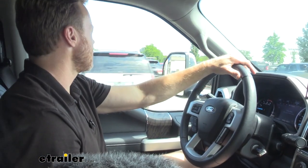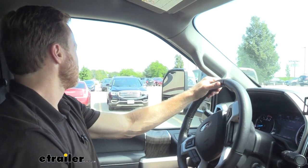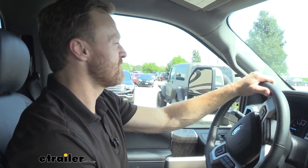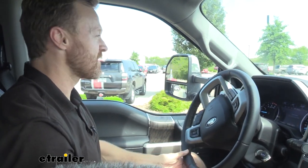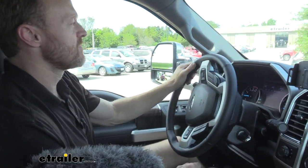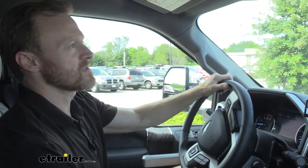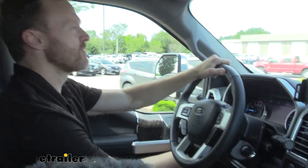Yeah. All right, now I'm gonna just apply the brakes. Hard to tell when you just push the brake pedal because it stops as it should, right? But when you use the brake controller without the foot pedal, it's fairly profound. How are your brake controller settings comparing now to where they were? Well, I'm at a 5 and previously I was at like 7 to 8. Okay, so quite a bit. Yeah, it's quite a bit.